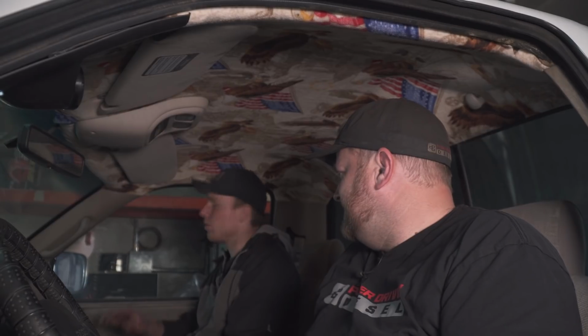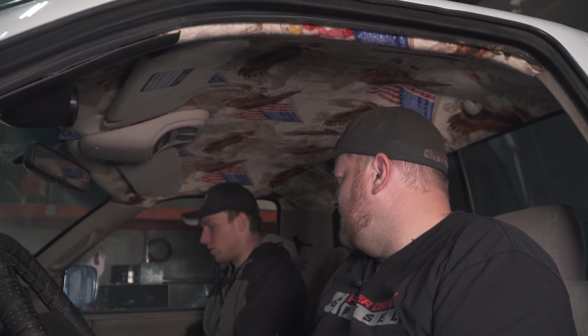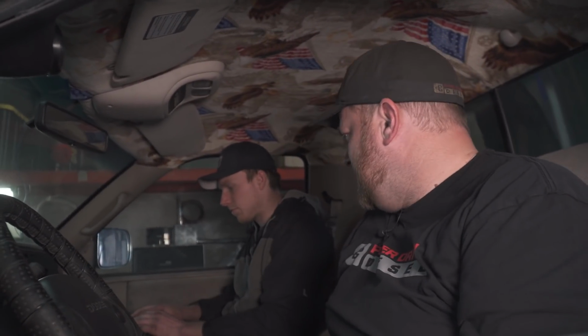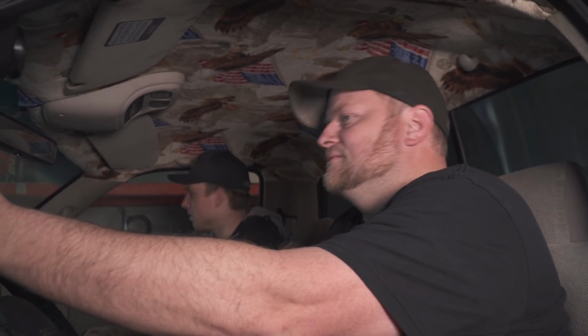A little nitro. All right, so now we're gonna do a max power run. 401. Oh, we should do another tow tune, right? Because we don't know if it was fully bled out. Okay, one more tow run. EGTs on the tow run. I'd say 1490. Really? Higher, right? Yeah. Want more fuel, more heat.